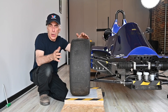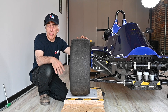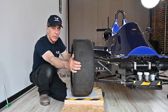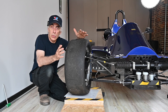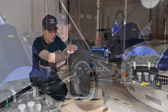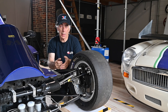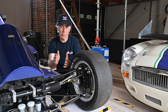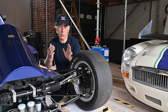Toe is defined as the position of the tires on the horizontal plane towards the center of the car. If the tires are pointing inwards to the center of the car, we talk about toe in. If the tires are pointing outwards, we talk about toe out. Both have advantages and disadvantages. Toe in is when both tires are pointing in the driving direction towards the center of the car, essentially pulling the car into a straight line, making straight-line driving very stable.